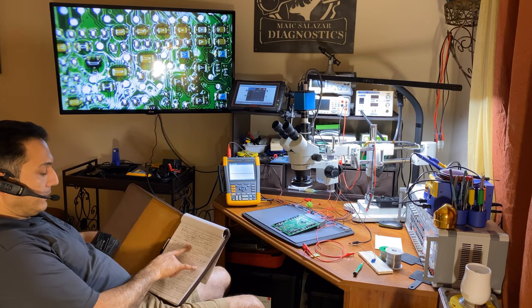Some MOSFETs have built-in diodes, which is why you see the voltage drop in calculations. Coming back to the main point: we have signal preparation, which converts a sine wave into a square wave. That's just a brief overview of the signal processing stages. Now let's get back to what we have today.